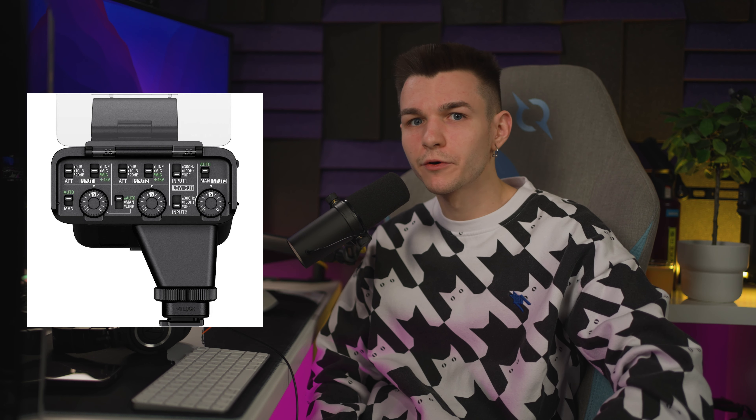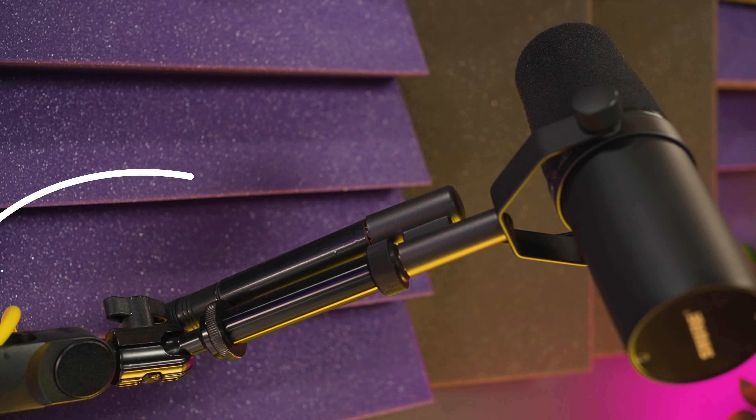Second, getting the SM7DB for on-camera audio if you use hot shoe preamps from Sony or Panasonic, for example, which also provide plus 48V phantom power. That will allow you to get a good clean signal from the SM7DB baked directly into the footage, synced without extra work in post unless you want to process the audio. But if you were already using the SM7B in this scenario with a cloud lifter, the only gain from getting the SM7DB is the comfort of not having extra cables dangling around — you'll just have a cleaner setup.